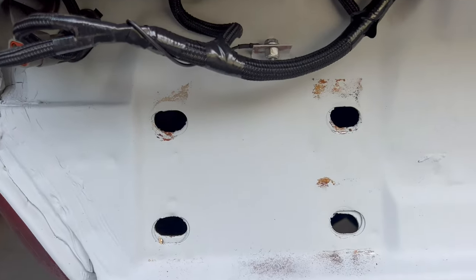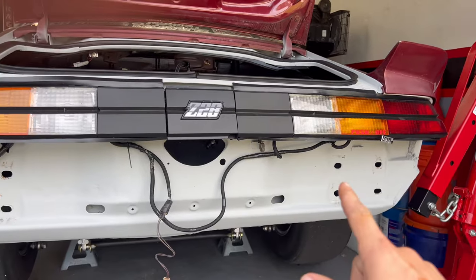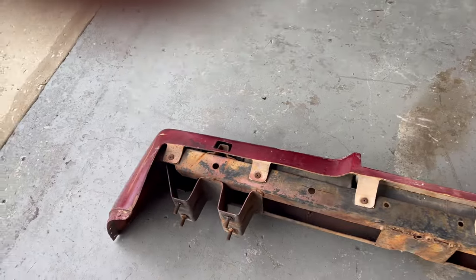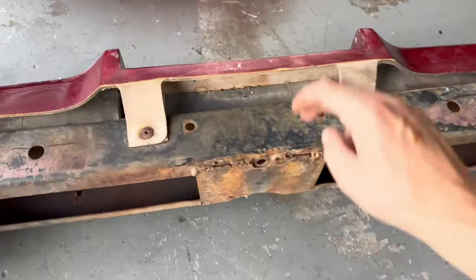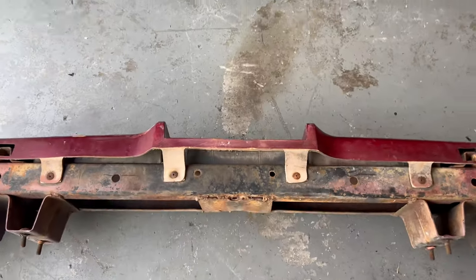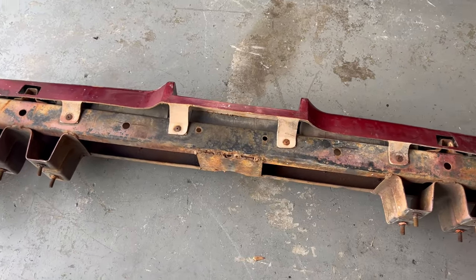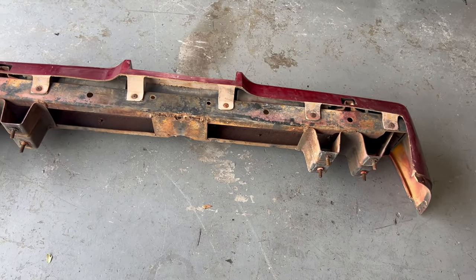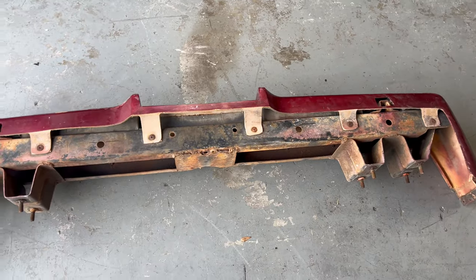This bumper bolts to the back of the car where the subframe rails are — look where the leaf springs are at, look where the holes are. A lot of builds like on Motion utilize those holes and run a bar through the bumper, but since this is such an over-engineered bumper support bracket monstrosity, I'm just going to take advantage of this heavy piece and make it the parachute mount. It's probably 45–50 pounds, but welded to the support it will be structurally sound, no doubt.